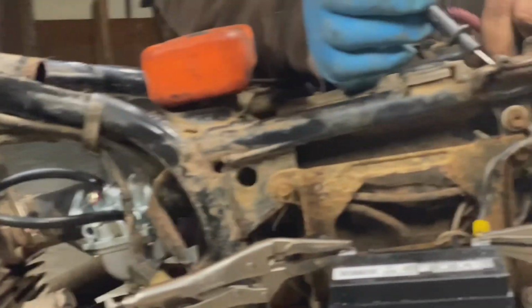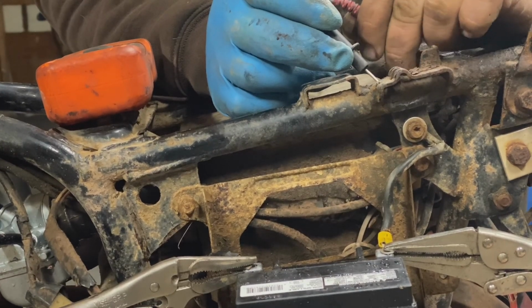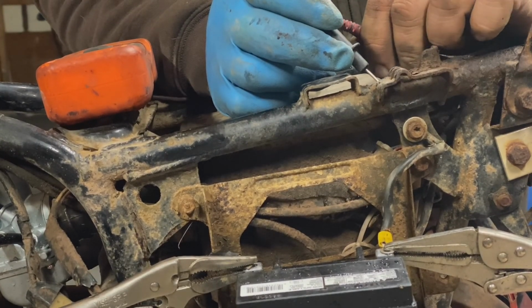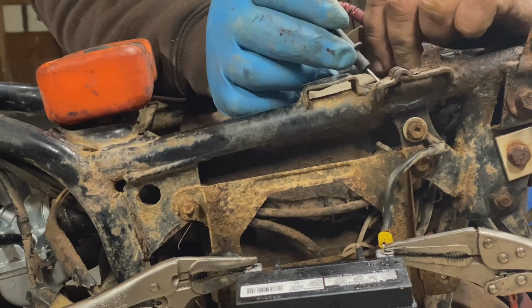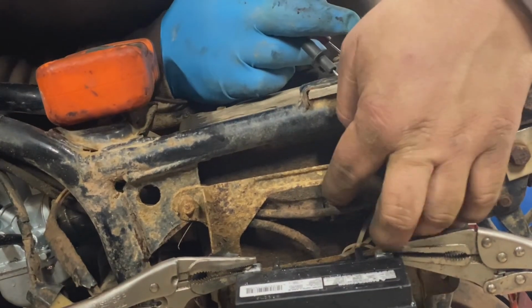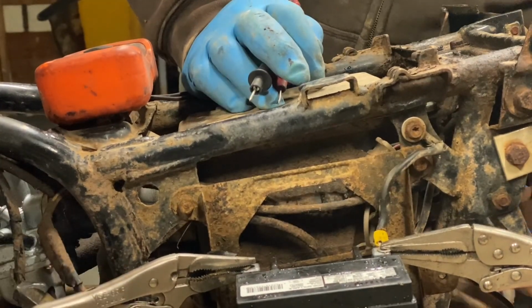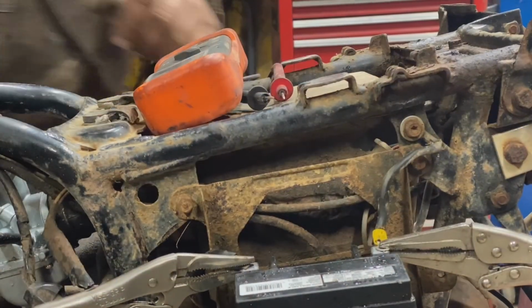Stitches over here is going through some diagnostic. He's checking for continuity in which circuit? I'm checking the starter relay first, so we might just have a bad plug somewhere. We just got to go over all of our connectors, make sure everything is connected properly. Got to be something simple, something that we're just missing.